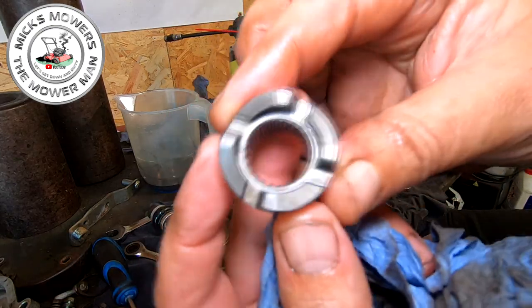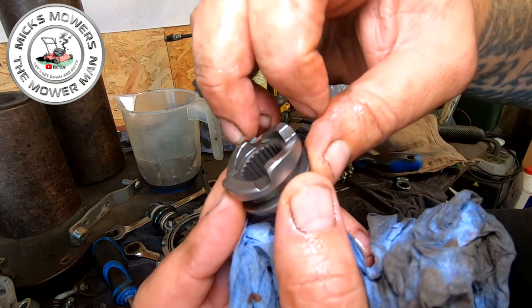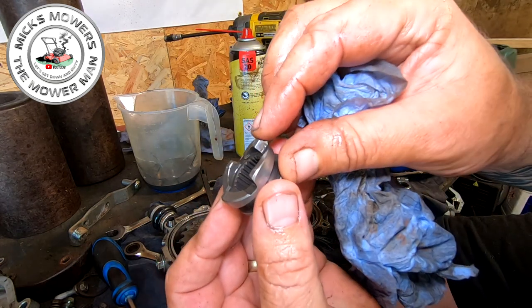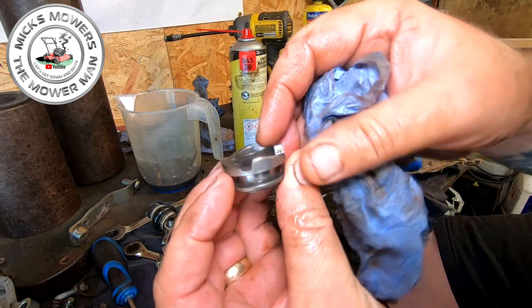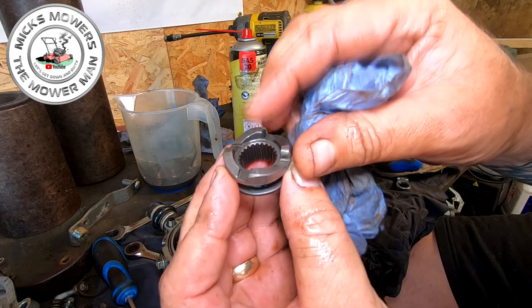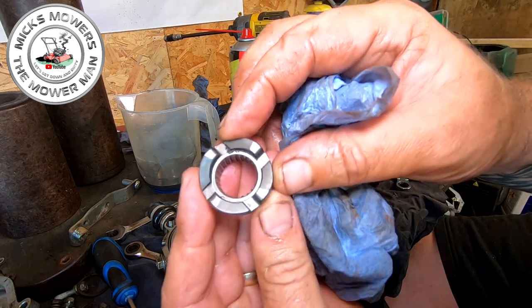So you can see all the top shine areas. It's a big step there, look. So these are all the areas that your clutch is actually worn. And what happens is your clutch just can't bite on there. There's not a lot to take off, really, to be fair. You know, it's not a lot of material. But that is why this drive isn't working.